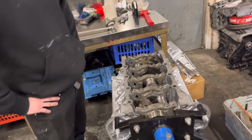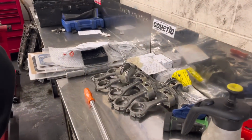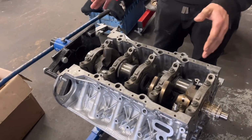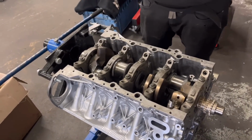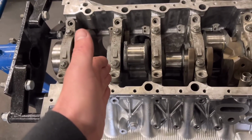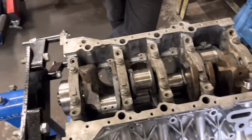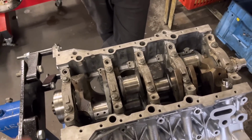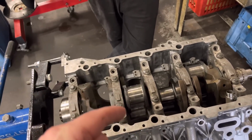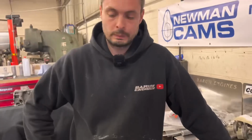Well, these are oversized mains. So these are all the bearings that are turned up from BMW, which are now correct. But obviously, they're not just oversized mains, they're oversized thrust as well. Excellent. So what he means by that is we've obviously had to grind the mains to 0.5. BMW lists 0.5, although they sent us standards when they were meant to send us 0.5s. They are actually colour-coded as well. Fortunately, the only colour that is available, we have gauged and it comes up all right on the clearance, doesn't it? Yeah, about 2 to 2.5 thou.